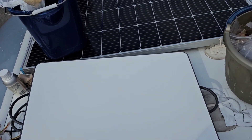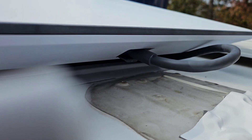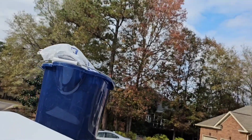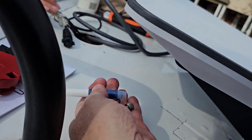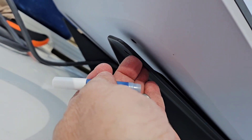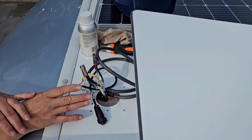First you put the knuckle thumb screws in the two bottom holes of the Starlink, then you slide it into place. We've already snapped in the connector — you hear a click when you snap it in, so you want to make sure you get that in place correctly. We ran it down through the center. They give you Loctite, so now I need to put Loctite on these two screws and screw it down here to secure it. Then I'll clean the panel and we'll have just the hole left to deal with.